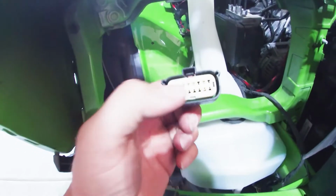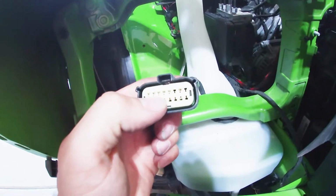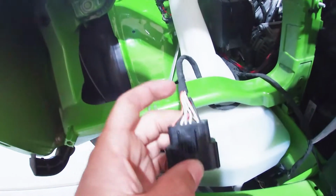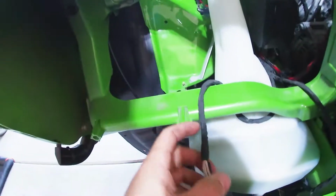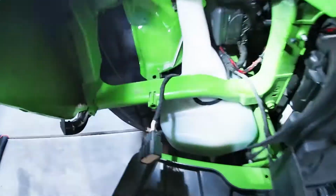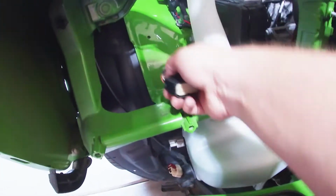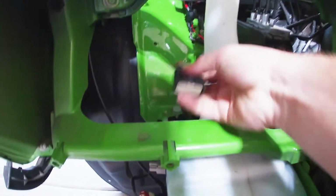If you're looking at the pin like this with the connector lock right there, it's the 1, 2, 3, 4th one over, the black and gray wire, and it's the same on the other side. You literally just gotta get some of the tape off the harness right there, back here, and then cut the wire in half, and then you just gotta solder in the yellow wire, which the harness is pretty long, so this will sit like back here when the light's in.